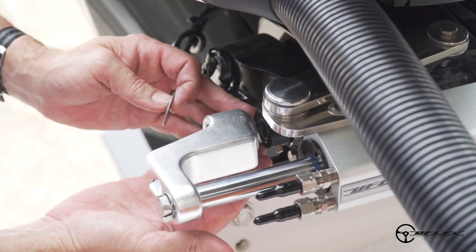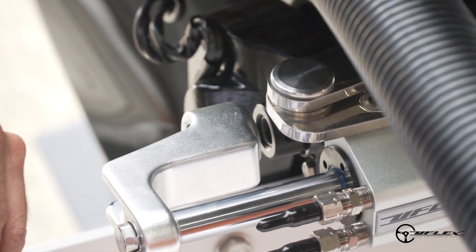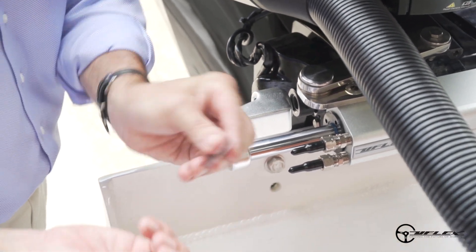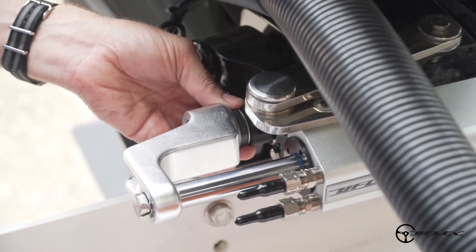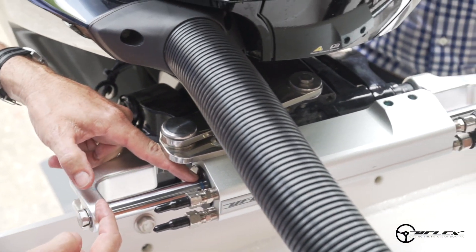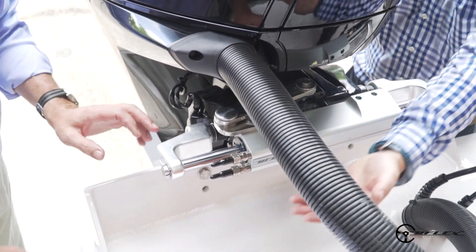Now the cylinder is straight and the space on that side is covered. On this side I have a little space that the adjustment ferrule will partially take up, but I'd still like to add a couple of spacers to cover that gap rather than relying too much on the ferrule. It looks like two mid-size spacers and the stainless steel washer fit nicely in there. I've now got proper spacers on both sides, the cylinder is straight, and the engine looks straight — we're ready to reinstall the hardware.